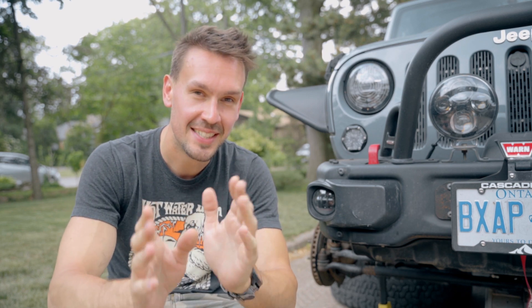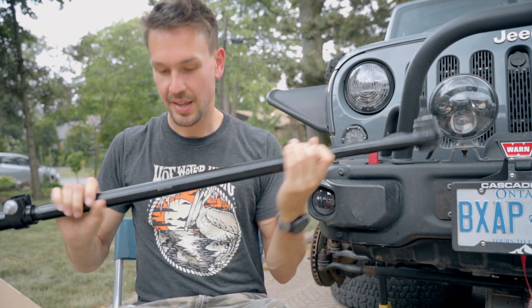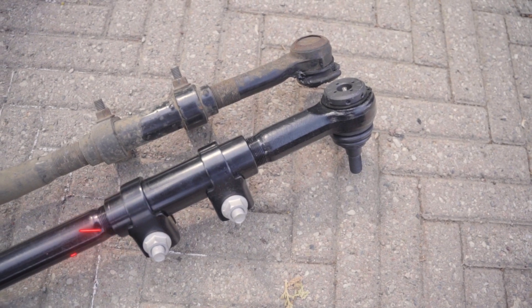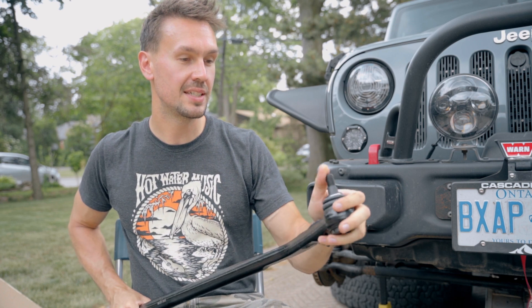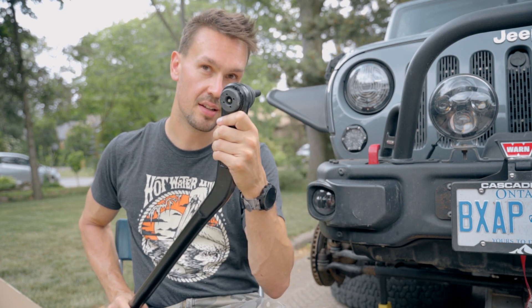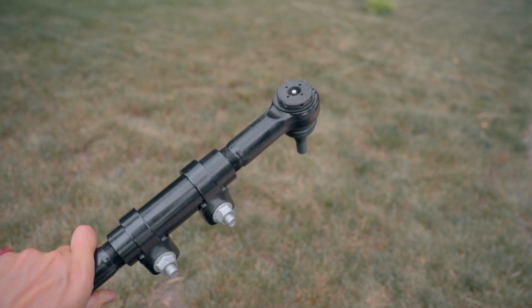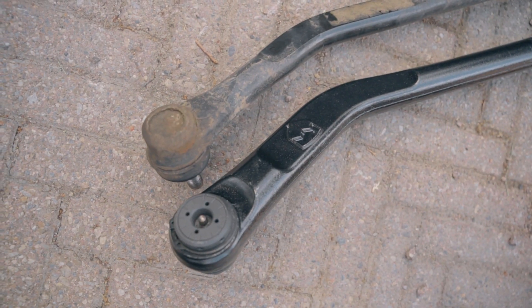Before we get into the install, I'm going to give you a quick overview on this drag link, tie rod, and Falcon Nexus EF 2.2 stabilizer. The drag link is going to bolt up into our factory location, and right off the bat it is hefty — one and a quarter inch outer diameter, so yeah, it's heavy. These ball joints are 50% stiffer, which should feel good when you're running bigger tires. These guys have 4140 chromoly ball studs, and they have a great design where the grease fitting is recessed, so you're never going to smash that off — it's protected.